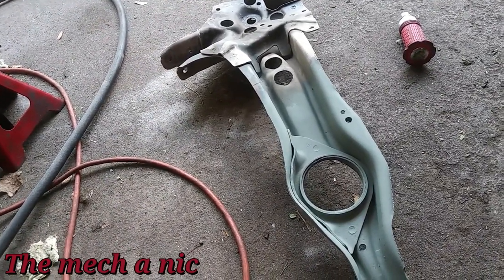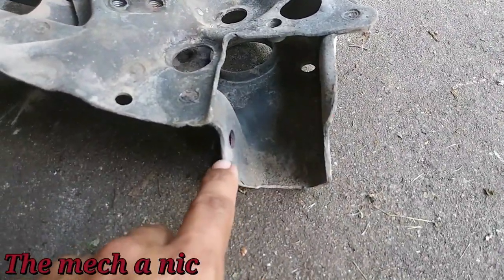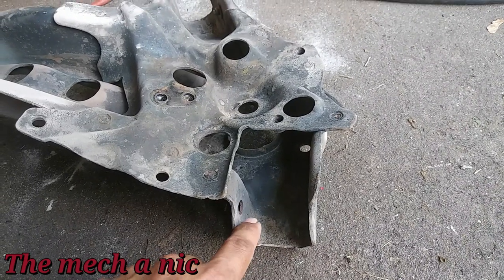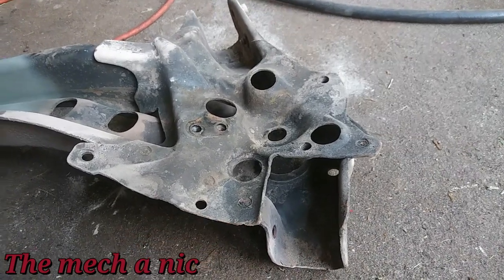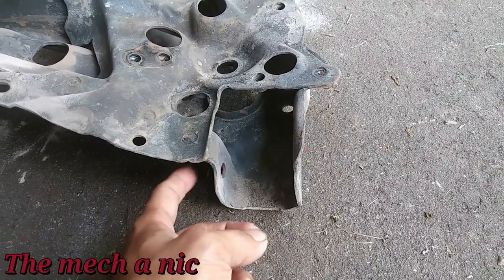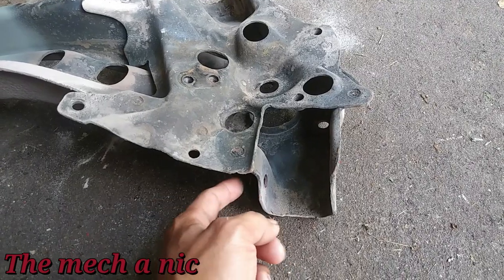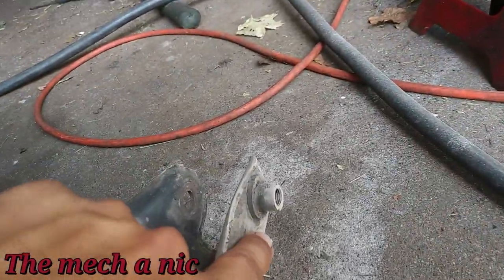For the past few days I've been fighting with a bolt that was stuck and broken off inside the threads. I tried everything — heating, cutting a slot in it, turning the nut red hot — and it wouldn't budge. So I got out the air hammer and just completely knocked it off. Now when I'm ready to put this on the car I'll just put my own nut on the back side instead of the one that was welded on.